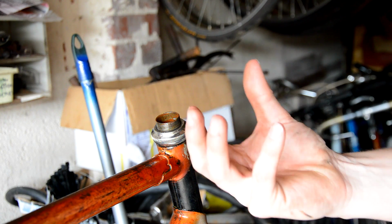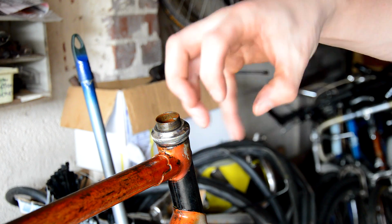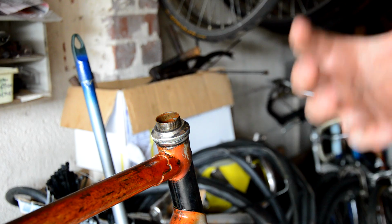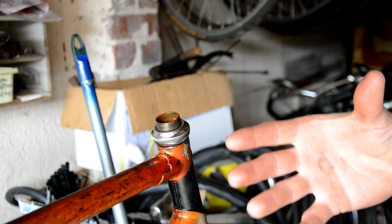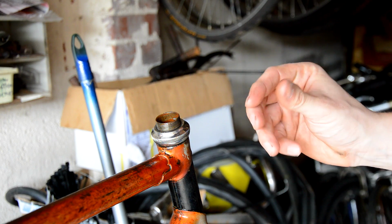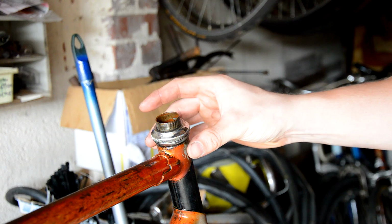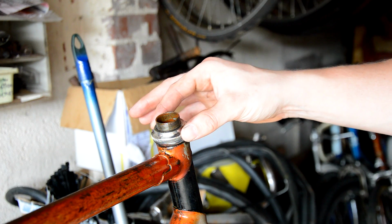And if it leaks out, or you know you've got a broken seal in there somewhere that the spray can actually get around it. If it doesn't, then you know it is solid in there, and the solvent spray will work at it. If that again doesn't help, then heat. Heat should shock it. So it's important not to get it too hot, but just keep at it.